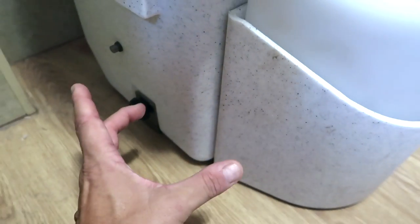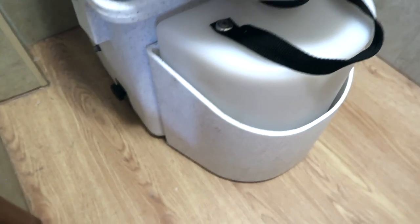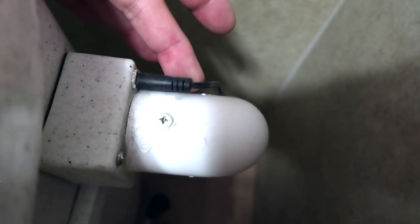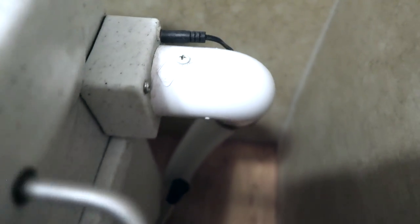Underneath here is the large three-and-a-half-inch opening that was for the old sewage system. It's still there in case we sell this and someone wants to put that system back in. There's the other bracket with the fastening knob, and there's the churn knob — you just turn it a few times after you do your business and it mixes everything up. You also have to connect power — this is for the 12-volt — and then there's the vent hose, which I routed down through the floor and into the wet bay compartment below so that it vents outside the coach.